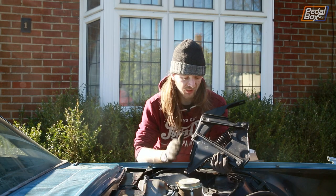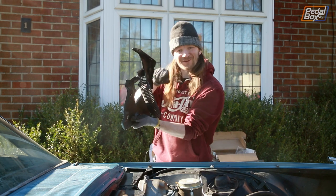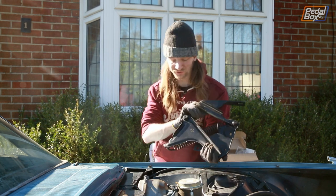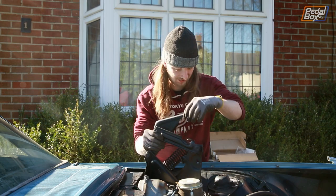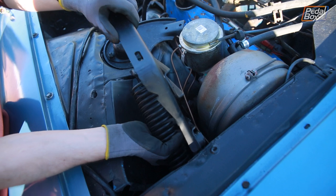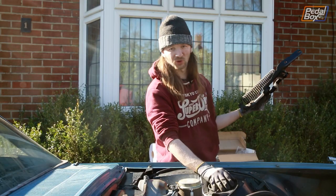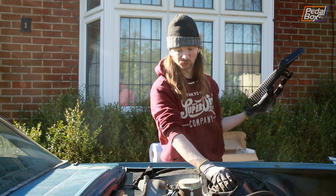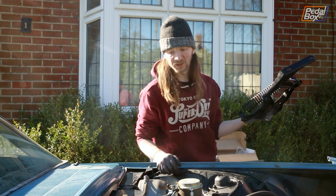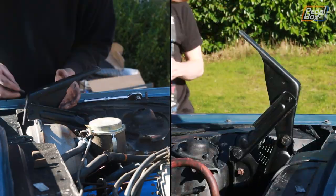The next four things we're installing are the bonnet hinges - I'm not going to demonstrate the action on them because I am terrified of that spring which is currently full of energy - but these just drop in and bolt in. There are a couple of fairly big bolts that run from here into the strut towers. Then once they're on we're going to get the strut tower braces that run from the tops of the coil spring and shock absorber units into the main cross member. With that the engine bay will be more or less complete and we can start putting the bonnet on.